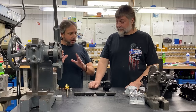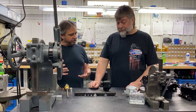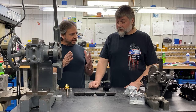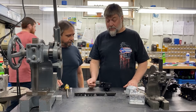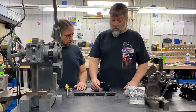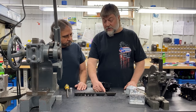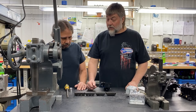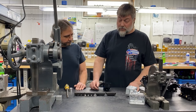So this video in the series of carburetor adjustment is going to be the float adjustment for the billet Enforcer. I see you have a lot of floats here, John, so the floats must make a difference of where you need it adjusted. That is correct. Not only is there a difference in adjustment, but obviously there are floats for different applications. While these primarily used to be a circle track float, we found some advantages with the angles for the front of the carburetor, also tunnel ram, different things. Obviously, for a single four barrel, you've got to have notches for your jet extensions. So that's the reason for the different floats.